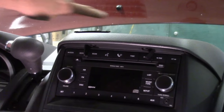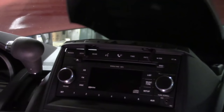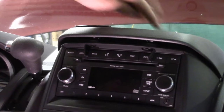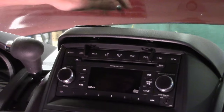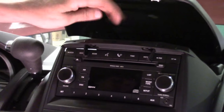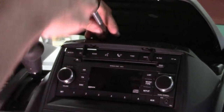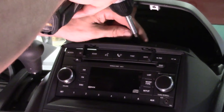That's going to allow us to get access to getting this top piece off. We do have a trim piece across the front of the dash we need to take loose, because once we pop this up, she's got fasteners on the side but there are also two screws at the front. So we can't get this completely off yet until we take those off, but we can go ahead and get the two Phillips screws off here and here. This holds this trim piece in place.